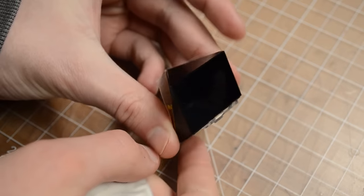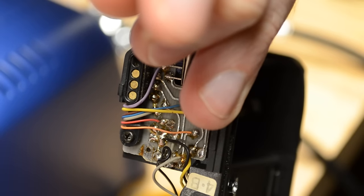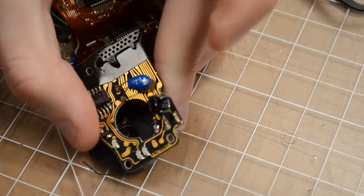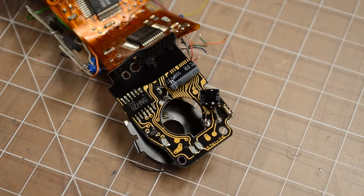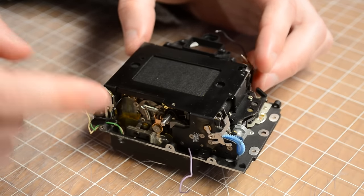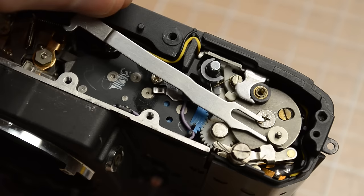Now that everything's nice and clean, we'll start to put everything back together again. The main failure point on these Minolta X700 cameras are the aperture and shutter capacitors that sit underneath and above the upper PCB. If you have the blue solid tantalum capacitors, you probably don't need to mess with this during a CLA. But with the later models that have electrolytic capacitors, I prefer to do preventative maintenance ahead of time to make sure issues don't arise when you're out in the field. When you attach the shutter back onto the mirror box, both the shutter and the mirror box need to be primed or else it won't seat properly. When you drop it into place, it releases the shutter and the mirror and it locks right where it needs to go. We need to make sure that this little timing mark is pointing straight at the center of this gear, or else the advance lever is going to feel sloppy or place too much tension onto the shutter curtains. You can also see the little brass eccentric screw which controls the fine tuning adjustment for the overcharge gear.